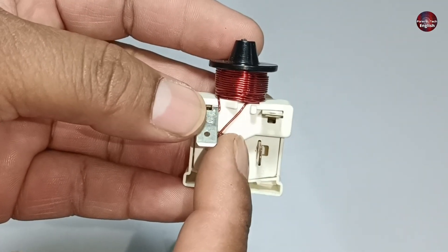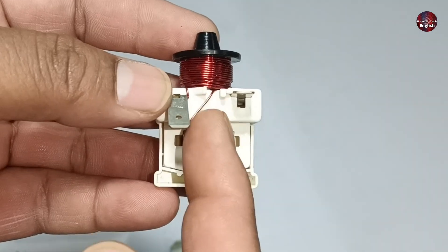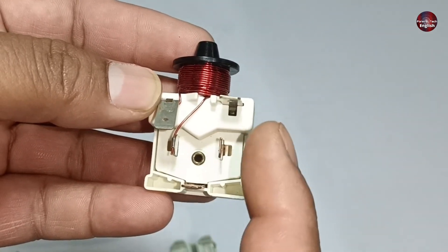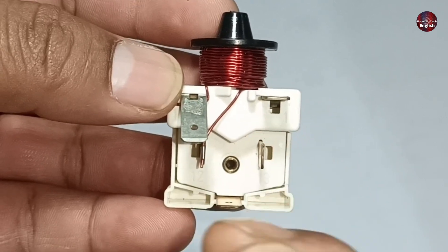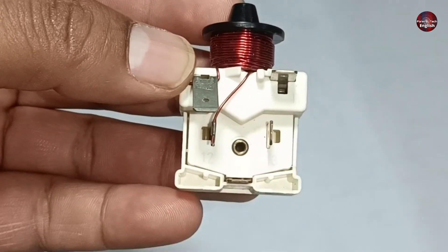The magnet was working absolutely fine. But the 2 connection points in that relay — through which the compressor starts — had a loose wire connection. Due to this loose connection, the compressor started sometimes and sometimes not. After tightening the wires, the problem was resolved.